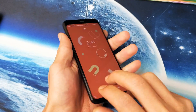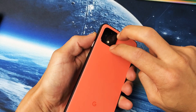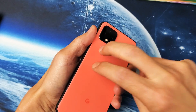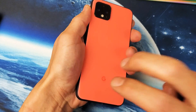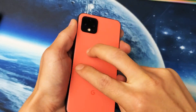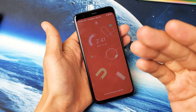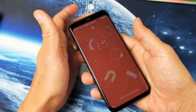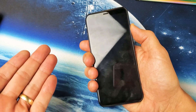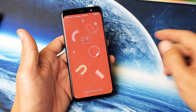Also, I'm not responsible if anything happens to your phone. After you're done with the screen, turn it over and do the same thing on the back, and even on the camera area as well — keep tapping that. Now turn your phone back over and do the same thing as step one: press and hold that power button, do not let go until you see the Google logo appear, then let go. Hopefully you guys are up and running. If not, we're going to go to the next step.